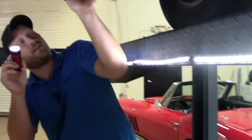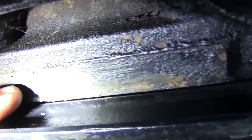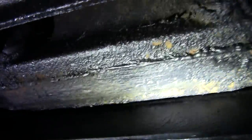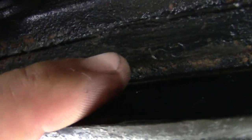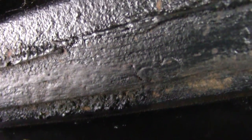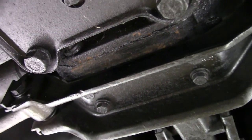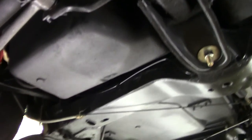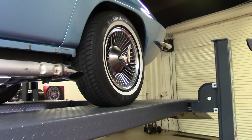The rear end — there's a date code on the bottom of the rear end, which is going to be very difficult to read. Most of it is gone; it's not a very good location for preserving the numbers. But if you look right there, you can see the '65. So that tells us that this rear end was assembled and built in 1965, which very well could be the one that came in this car. There is not a VIN number on the rear differential linking it directly to this car, but if the date matches, you pretty much assume it could be the original one.